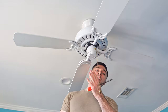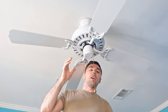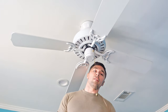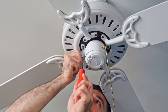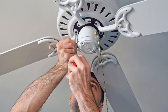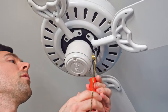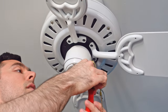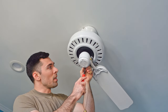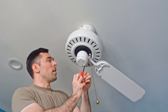Now I'm going to remove the fan blades. If you have a different style fan, you may have to deal with the glass and the light bulbs first. In this case, I don't have that — all I've got to do is deal with the fan blades and then get the motor unattached. I have two screws here that secure the blade to the motor, which is pretty common on basically all fans. I suggest you work on fan blades that are on opposite sides of each other — that will keep the entire unit balanced, so you don't end up with one side that's really heavy.